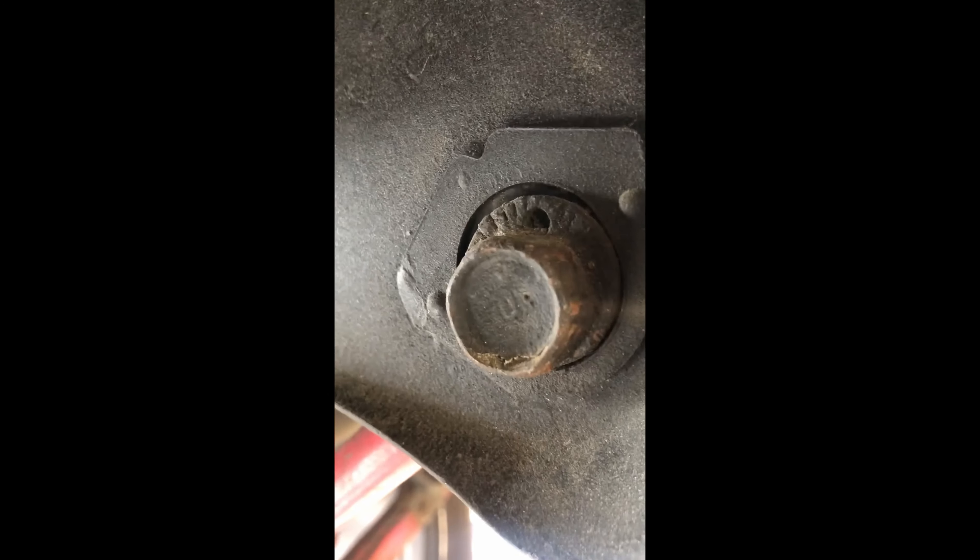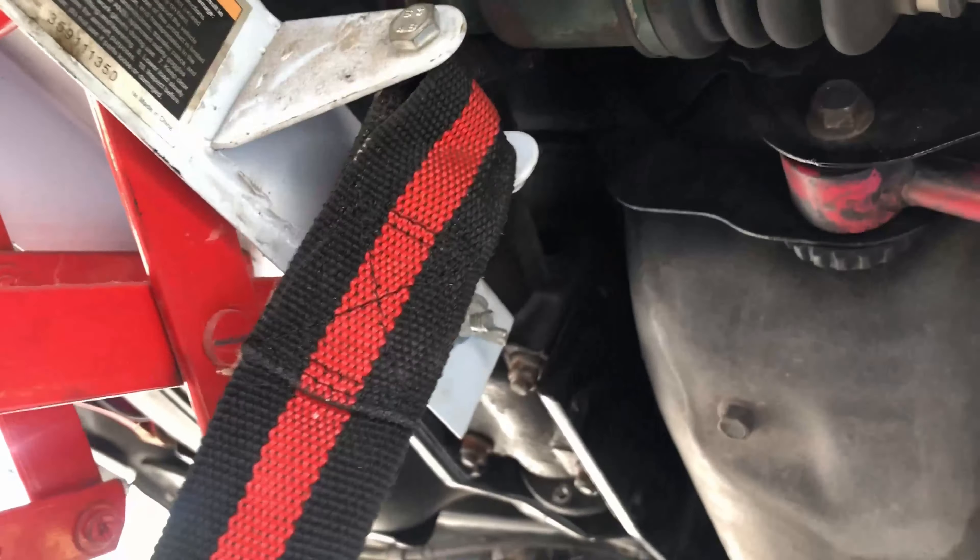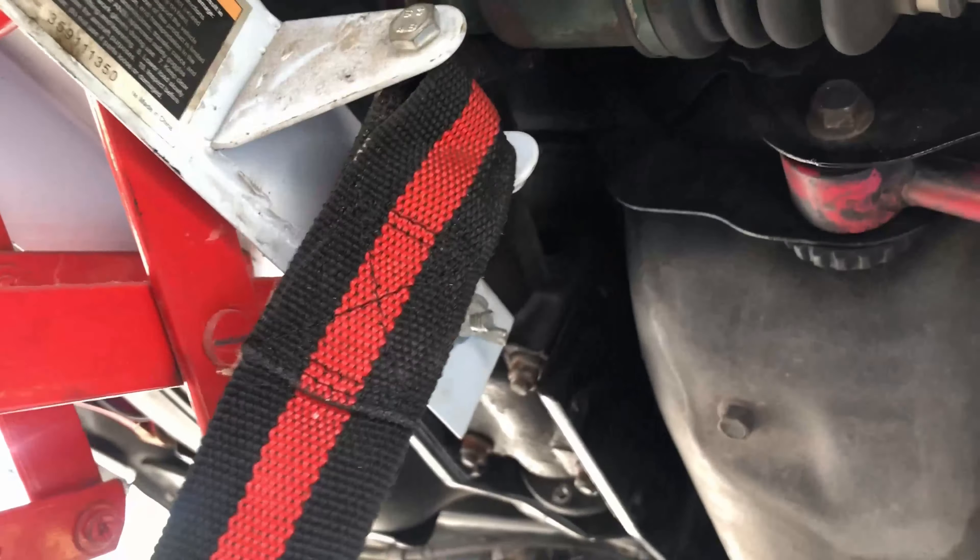Next I'm going to remove the mounting of the outriggers — those two 10-millimeter wrench bolts. You should take a video of the position of the rear bolts before removing them, as these affect the rear toe. The rear lateral link bolts have markers on them, and there are marks on the housing in this area. There's also a hole which clearly marks the position compared with the notch in the rear cross member.